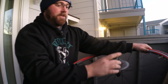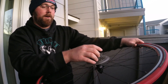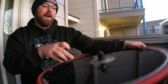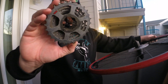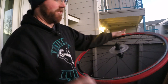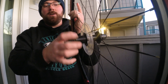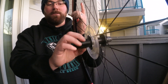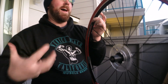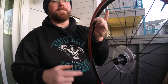As you can see, the first two gears on this one are separate from the rest, and you can just grab the whole body and slide it off. Now if you look at this, it's just gears — there's nothing else there. And if you look at the actual wheel, that's your freehub body right here. So the difference is the freehub body is built into the wheel on a cassette, versus a freewheel where it's built into the actual gear assembly itself.